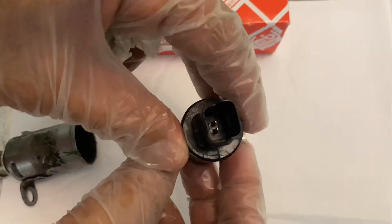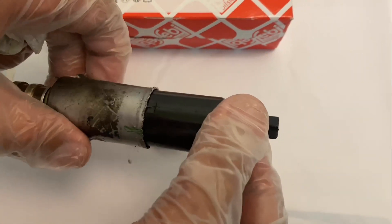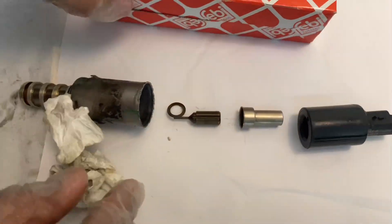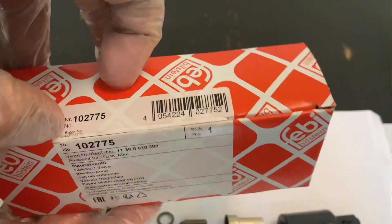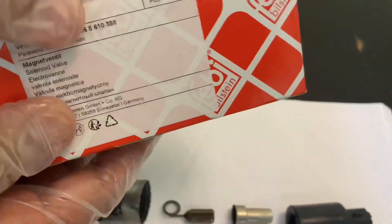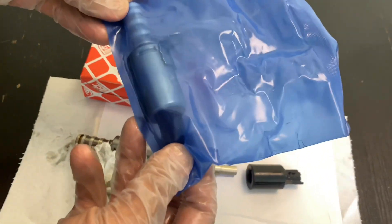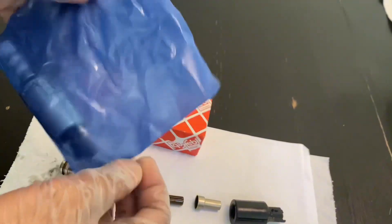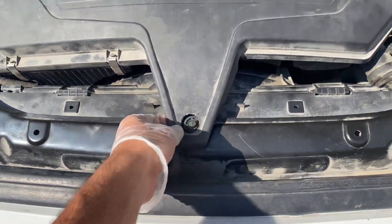The enclosure goes into the filter part, and this is the electrical solenoid which actuates the piston. This one was completely dead — I tried connecting it to the positive battery terminal but it was not clicking. This is a new Febi solenoid I bought, which is much cheaper, in really nice condition, and is an exact copy. I tried it for a couple of kilometers before making this video.